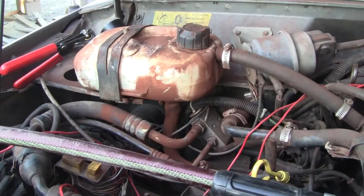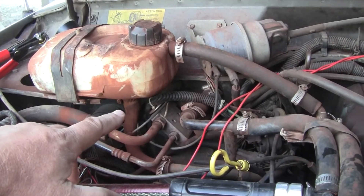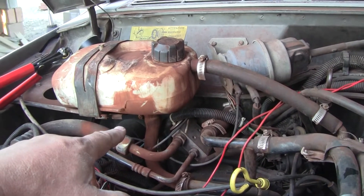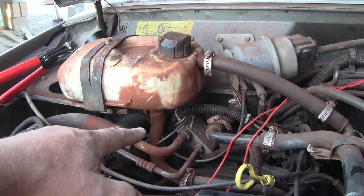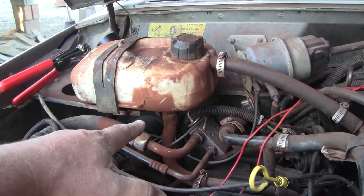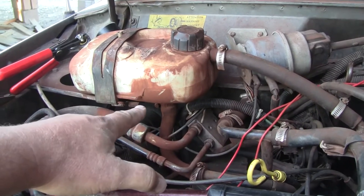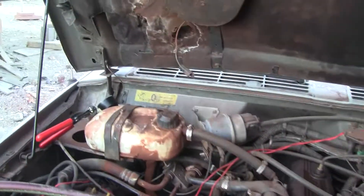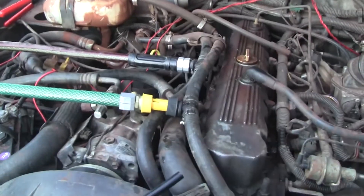I bought a new one but I don't know if I'm going to use it. You see the hose under here — it's stretching over a one-inch nipple using five-eighths radiator hose. I couldn't believe it. The lady was going to sell me five-dollar-a-foot inch hose, but I went and looked and they must have used a heat gun to stretch five-eighths hose up to one inch. So anyway, this whole system is pressurized, including the cap and the overflow bottle, so you've got to be careful.